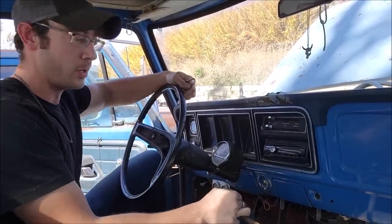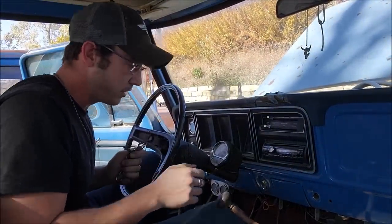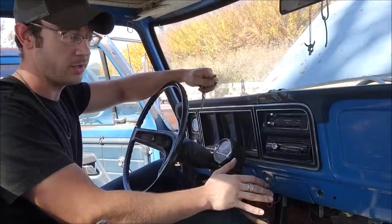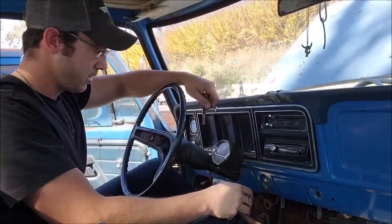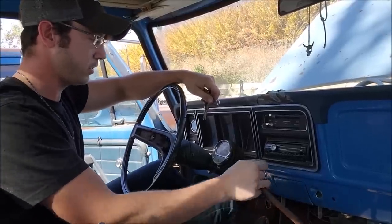Haven't been in here for a really long time. I technically committed the carnal sin where on a manual vehicle, if you park it for a long time, you really want to wedge the clutch pedal down. Reason being is the pressure plate and clutch disc can all kind of seize together. But this engine leaks enough oil, so I wasn't really that worried about it. And it seems to work. Brakes go to the floor, as is tradition.